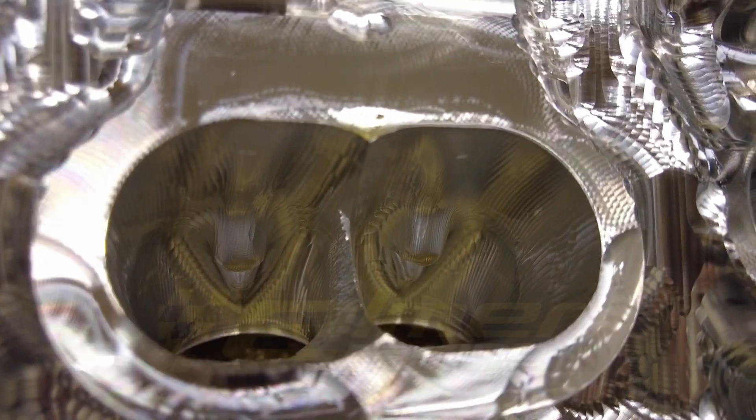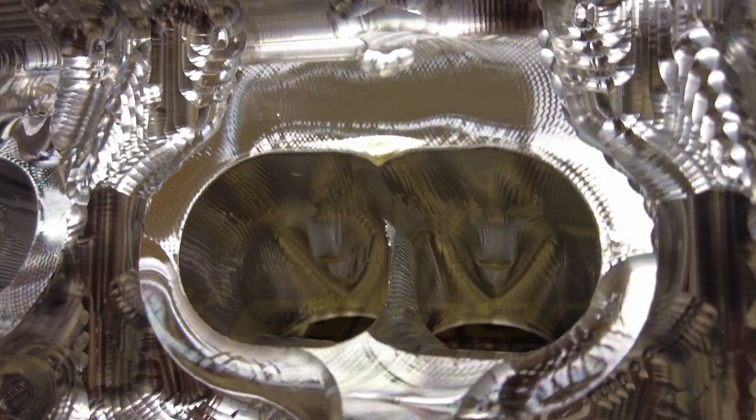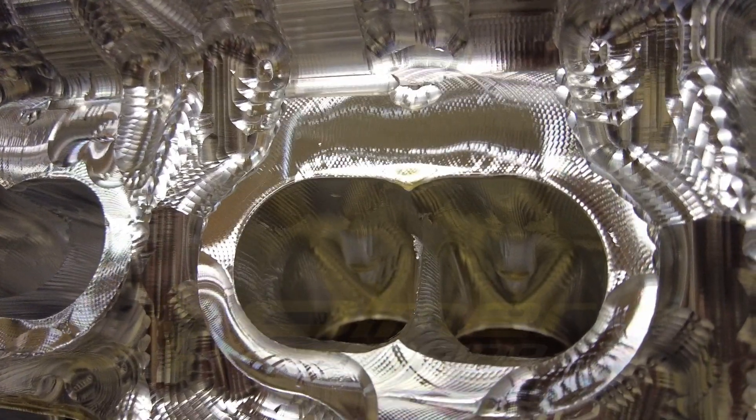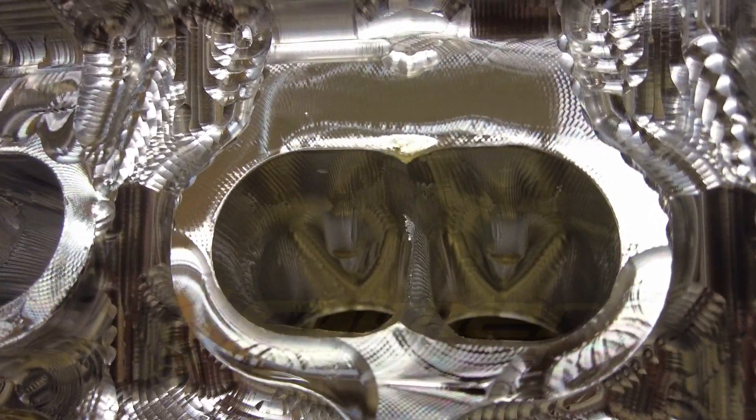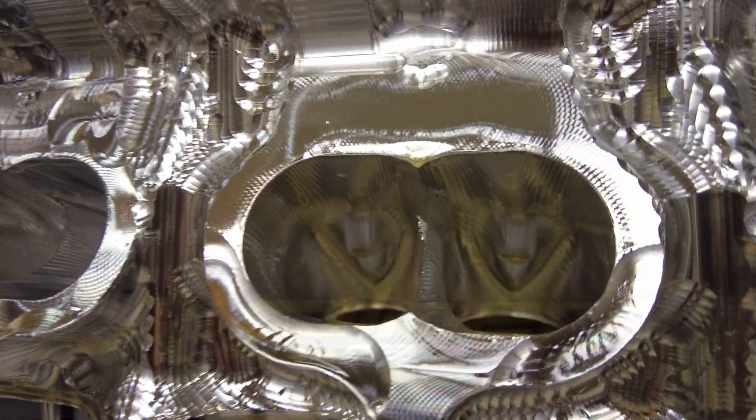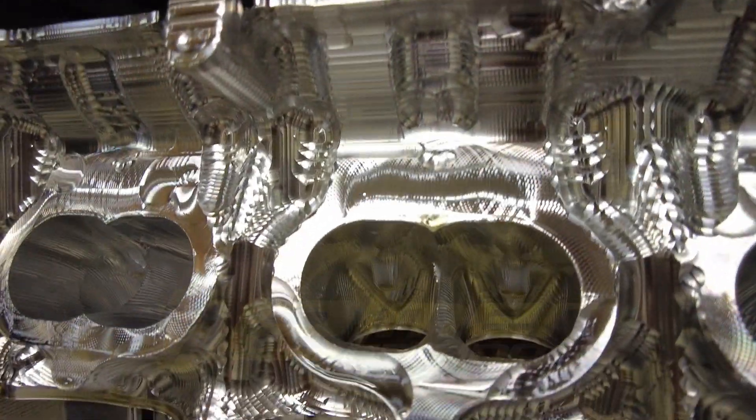This is the intake part here — we have some decent contouring. There is a slight problem with the VR38 engine and engine bay size: Nissan really crammed it into as small a space as possible, so they lowered the cylinder head and camshaft height as much as possible. It has really short valves, which dictates that the valve guides need to be really close to the valve seat. On the VR38 cylinder heads, the ports do a really sharp turn, which is not very good for flow.